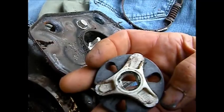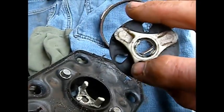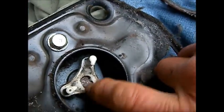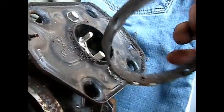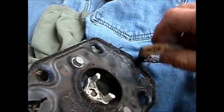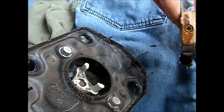This is the drive coupler — it goes in between here and here. There's a spline in there, that spline will go out. And if you look here, that spline is lined up with the spline on the main shaft. This is the clutch. If your clutch is worn down where it's rubbing on the brass rivet, then the clutch is no longer any good. This clutch here has a little bit of surface rust — I may clean it up, but the surface rust actually helps the clutch grab. I will clean it up before I put it in.